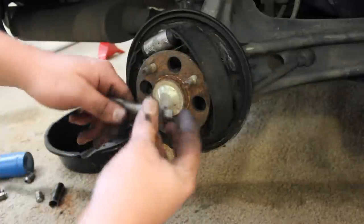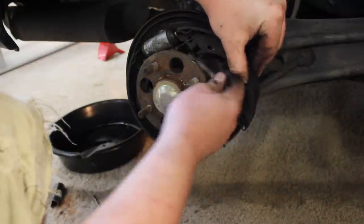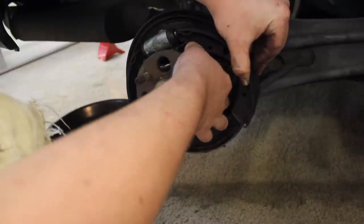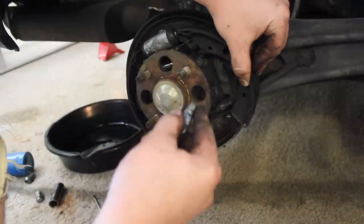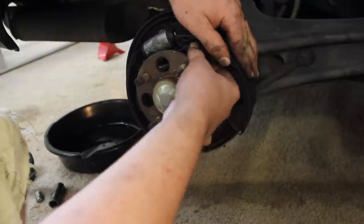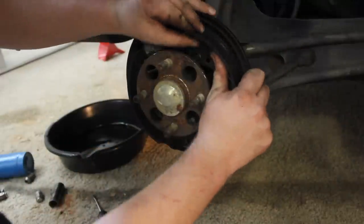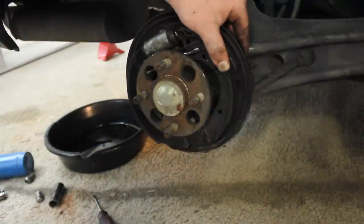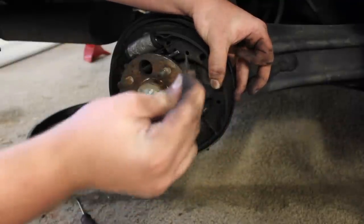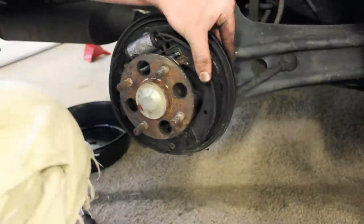The next thing we'll do is take your star wheel adjuster and we're going to slightly lift up on this side. Remember, that shorter side goes towards the back. So I'm going to stick it in there. I've got it set in there. Then you're going to take this piece and set it on the end there, and get it in there like that. Just lift it back up and set it in there. Now that we've got that all loaded, the next thing you want to do is lift up on this shoe here a little bit, then go ahead and fit that little notch into that hole right there, and then let it back down. It will be all set up just how it should be.